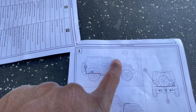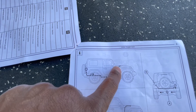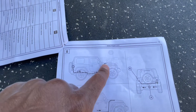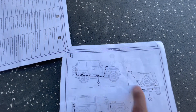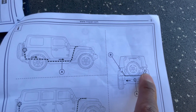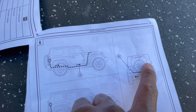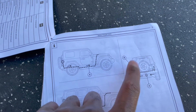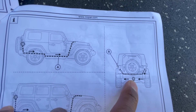I didn't remove those front fasteners - I just found a way to route the wire up into the hood. It came out on the passenger side at the fuse box, and I fixed it to fuse box position number one, which is the frontmost position. In the rear, all the wires go in through the passenger tail light - the whole wire loom goes through there.